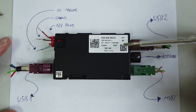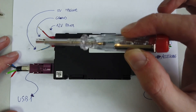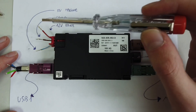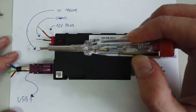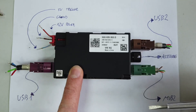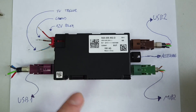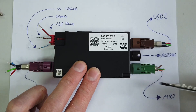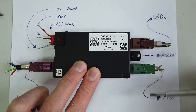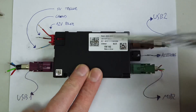This is how this device works. We have five connectors total. This is the power connector with three wires: this is 12 volts, this is ground, and this is 5 volts. The ground connection goes wherever. The 12 volts should go to the fuse box and the 5 volt goes to the infotainment MIB unit - this will trigger the device to turn on, it's just a trigger. Then we have four HSD connectors. The green one goes to the MIB infotainment unit, using the wiring currently going to your single USB port. The purple one and the brown one go to USB 1 and USB 2.